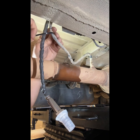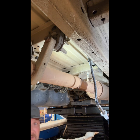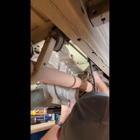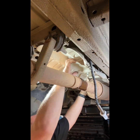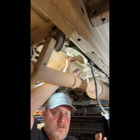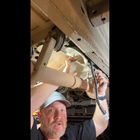Put another zip tie right back where you clipped the old one off, right about there. Take your heat shield and just kind of roll it back up in there. There are three new clips. If you're at home and you don't have three new clips, you can bend this heat shield out of your way — though I don't recommend doing so. But if you want to bend it out of the way, you can get the sensor replaced without taking the heat shield down.